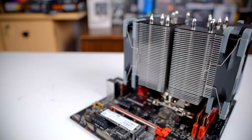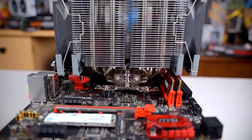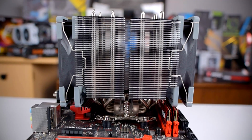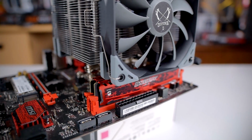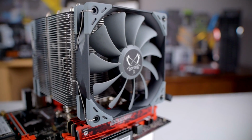The $60 Ninja 5 is a very large, really very large dual fan tower cooler. With both fans installed, it comes out to 138mm wide and a very hefty 180mm long. That's almost the entire length of a micro ATX motherboard, not including the rear I/O connections. Despite its enormous footprint though, Scythe made the smart choice of limiting the height to only 155mm, which means it will fit into the vast majority of ATX and micro ATX cases.